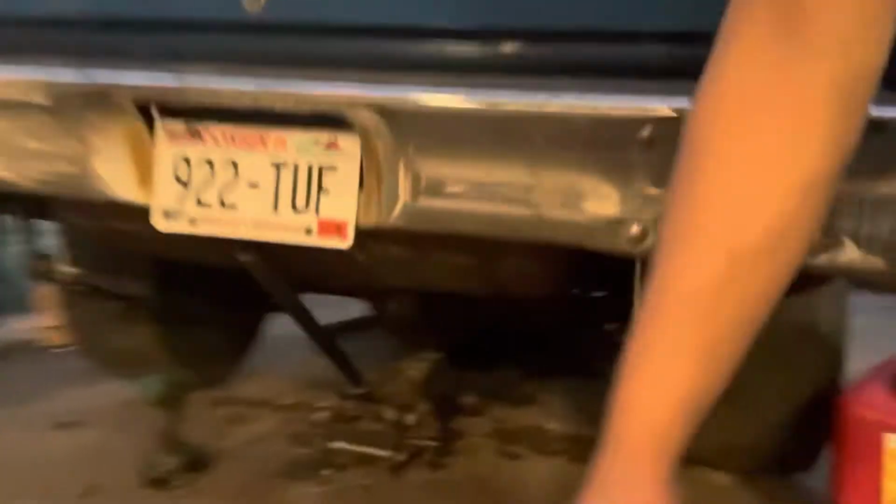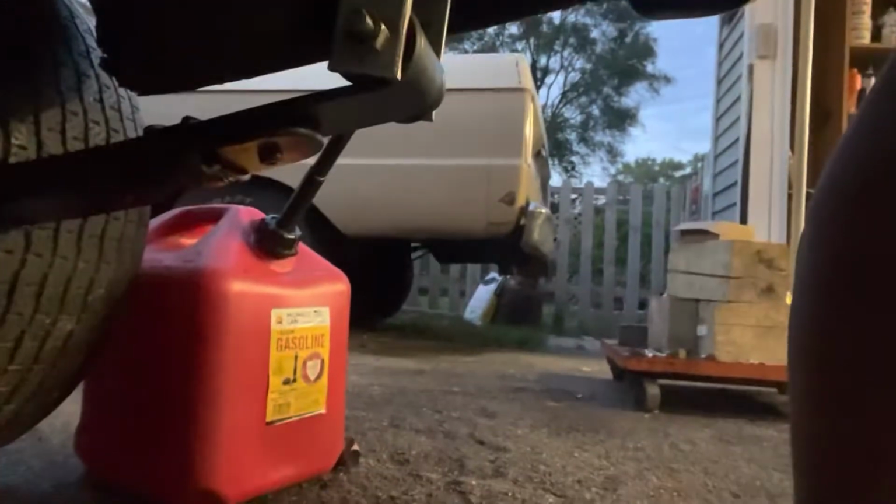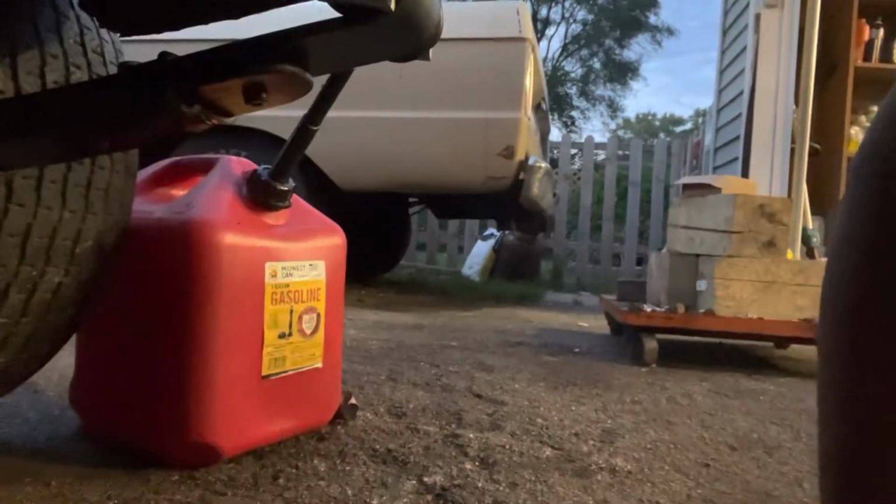The rear end, I started trying to figure out on the Falcon. I had a buddy come by when he dropped off the carb. I made him bounce on the bumper. These springs are terrible, and the shackle geometry is horrendous. A lot of people are talking about the diagram or the chart for leaf spring stuff. I'm sitting at like 120, 110, 120, 30 degrees.